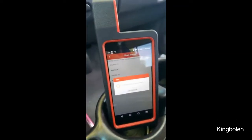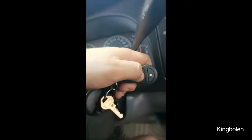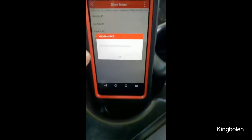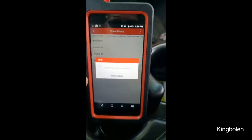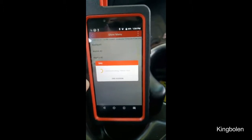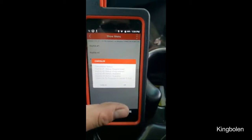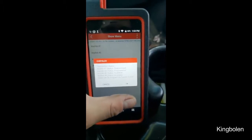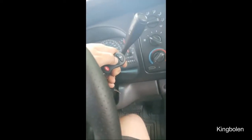Using this hand through the steering wheel — I'll press OK, press lock, press unlock. I heard it! Press OK to verify. That one's been programmed. Make sure I don't program the same one twice — it says 'programmed.' Press OK, on to fob two — press OK, press unlock and lock. Heard it! Both programmed. Key fob one and two programmed — let's make sure these work. Heck yeah, they work!